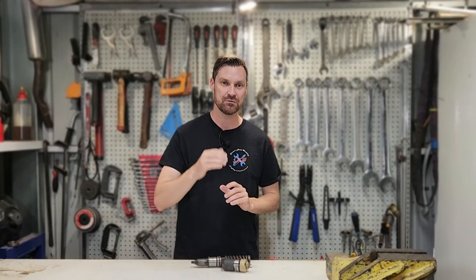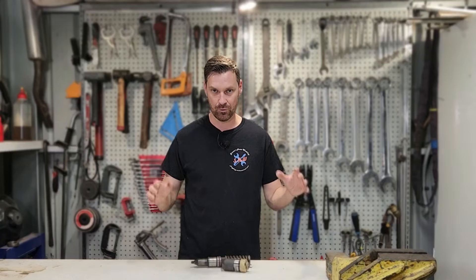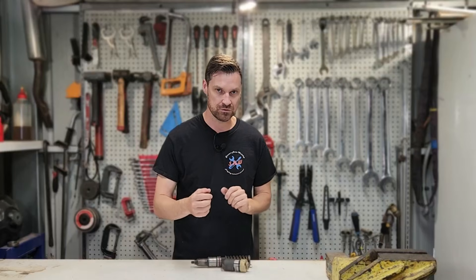The jake brake does this by opening the exhaust valve out of time from when it usually would, and that gives us the sound. We have that compressed air getting released through the exhaust valve, and then the exhaust valve opens again on the exhaust stroke as well. This allows us to slow the engine down and maintain the speed of the truck going down the hill. On a six-cylinder engine we have three jake brake actuators, and we can turn on just one or all three to give us progressive braking — so all pistons can be working against compression.